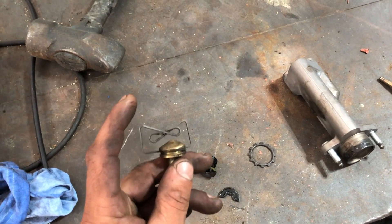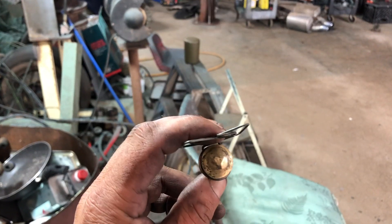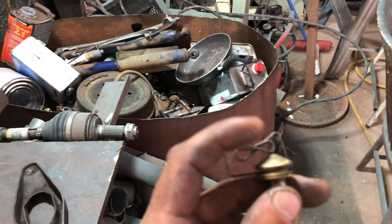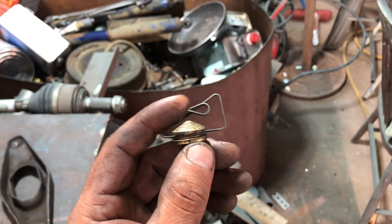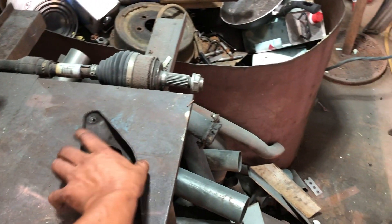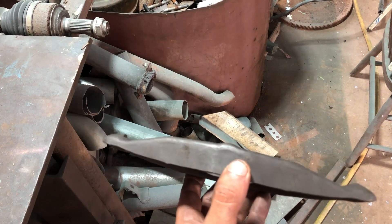What caused this — a few videos ago on this car we replaced the pilot bearing. I'm guessing that bearing was causing vibration on the fork and it chewed the brass away. When I took it apart last time I didn't take note of this, which was pretty unfortunate. I assumed a brass piece should last a lifetime, but as you can see it is extremely worn.